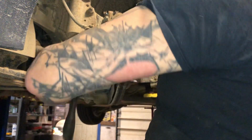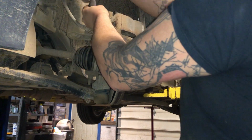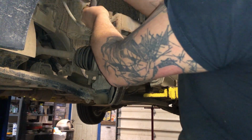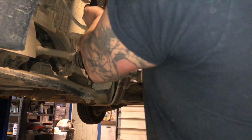And then we gotta do the other side and prime the brake pedal. That's getting those caliper pistons to press up against the pads so they're tight where they're supposed to be. So press that brake pedal in and out till your brakes are stiff and tight.